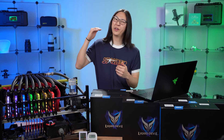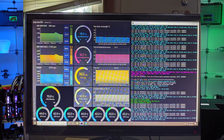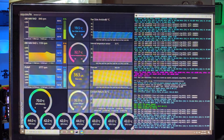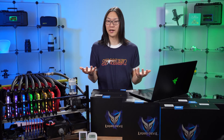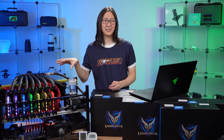The way I have things set up, the GPUs have anywhere between 35 to 48 degrees Celsius range of operation. The big range really depends on ambient temperature — if the ambient is around 60 to 70 degrees Fahrenheit, GPUs run at around 45 degrees, which is pretty good. This thing has been running at 100% the whole time. You can hear the rig in the background — it's not dead silent, but it's pretty quiet.